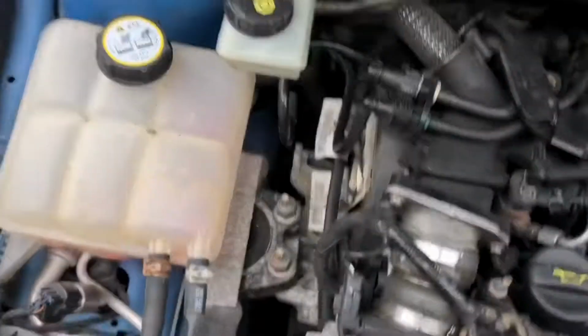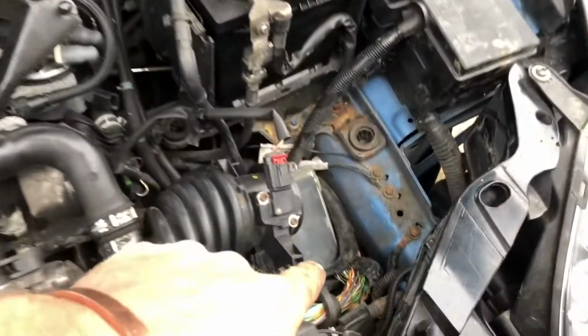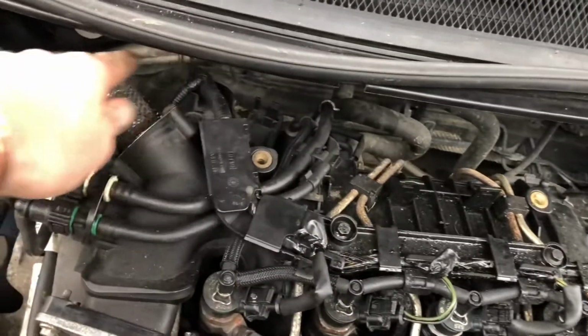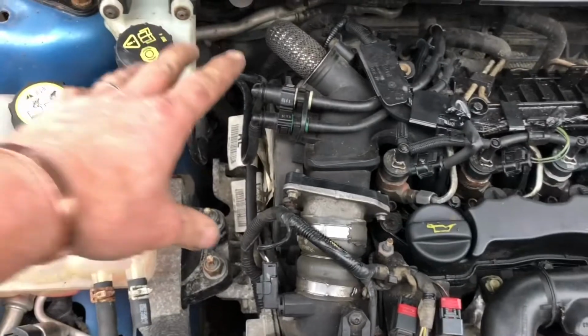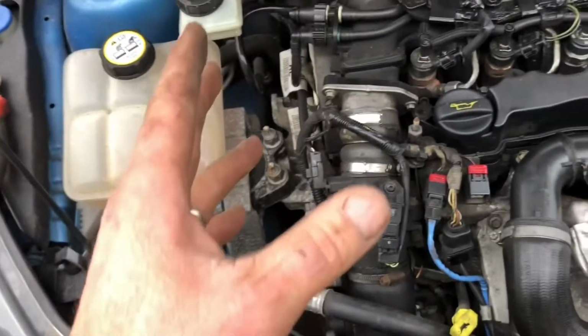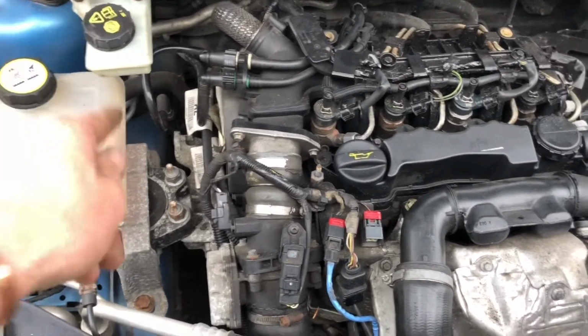What I'm thinking is, if I have any form of a short in my wire between point A, where the crank sensor is, and point B, where the ECU is, and anywhere along the line, because I'm looking at my injector wires coming back up and down and around, so they're in the same loom, they're knotting together somewhere down here. And I have this strange signal thing that you didn't see yet.